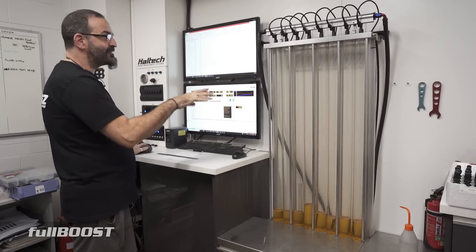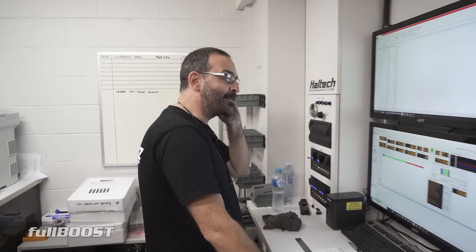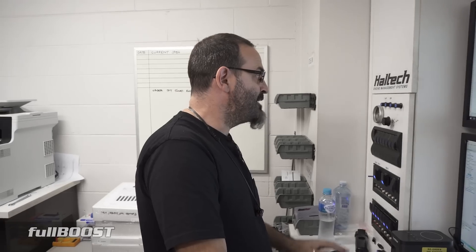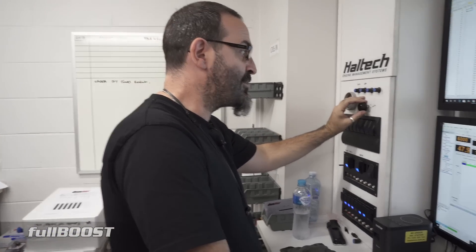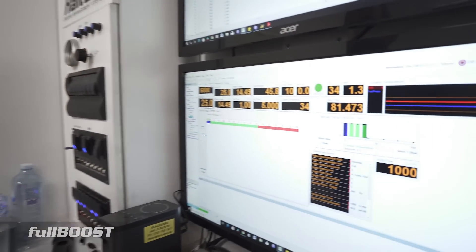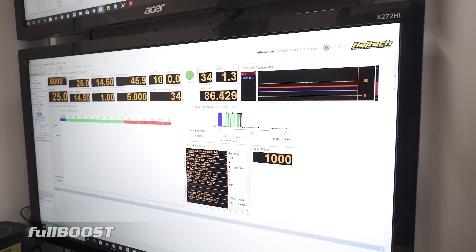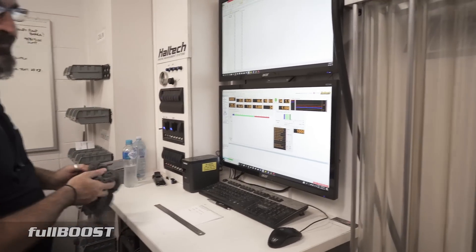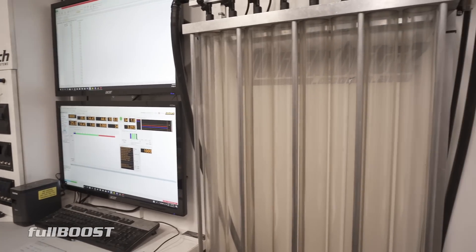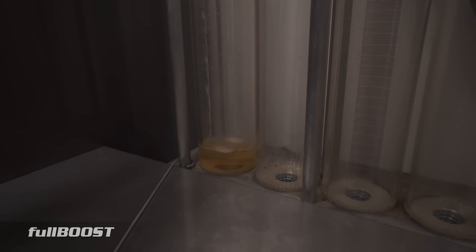So that was running at 75% duty cycle for 60 seconds and now we're going to drop it back down to 20 seconds and adjust our duty cycle to 25%. What we're trying to do here is obviously trying to mimic being operational in an engine, and we'll do one by one now. So we just keep doing the same process until the box is complete.